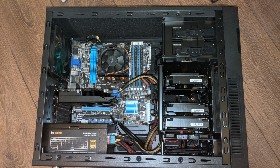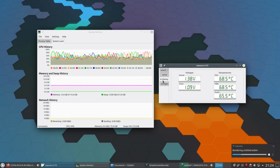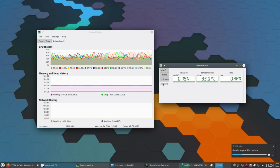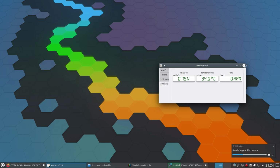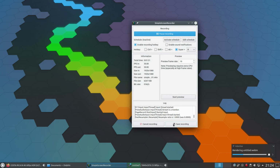Yeah, I really can't stand the manufacturer provided CPU coolers. They're far too noisy and uncomfortable to have, because as soon as you start running the CPU flat out, you're generating a lot of heat. That heat needs to be removed. The fan is very small, so the fan has to run flat out, which makes a lot of noise. The bigger coolers with the 12 or 14 centimeter fans have a nice big area, and the fans move slower. You can push more air through with a slower speed.